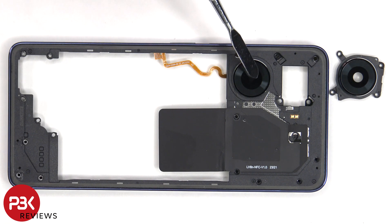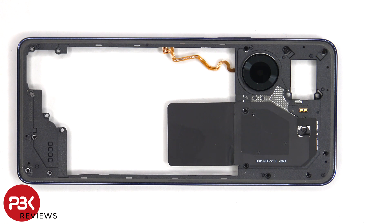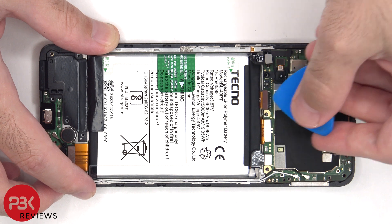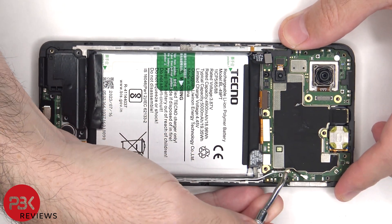The glass and the camera lens covers can be replaced by applying heat and prying them off, so you don't need to take apart the phone to replace those. The dual LED flash is located here, and the NFC antenna is located next to it. There's also graphite film to help transfer heat. Looking at the other side, we can see multiple antenna flex cables around the border. The two coaxial cables on the right side of the board can be disconnected by popping them off.